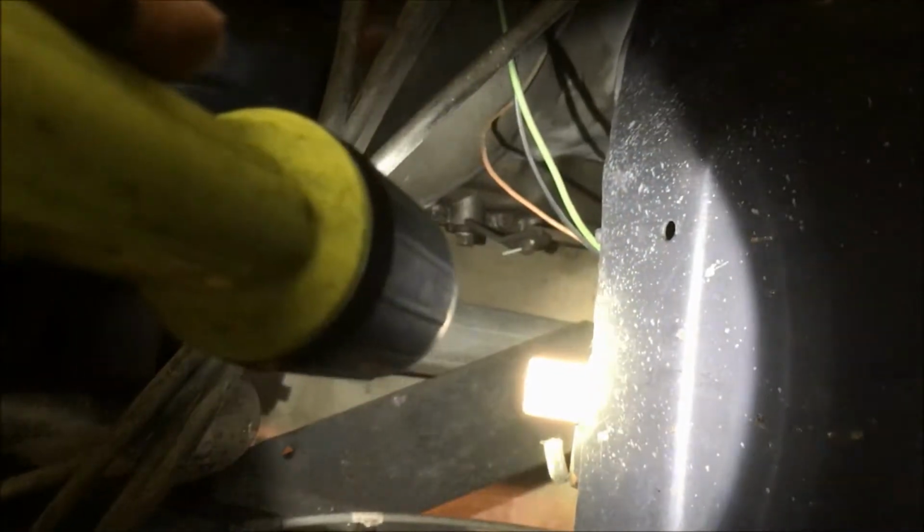It looks like I might be able to go with a U-joint down near the box and a U-joint up here, and that would make everything so much simpler. But I did mark the header tube. You probably can't see it, it's in black, where I want to dent it in a little bit. When I do that, I'll use that shaft on that end, some wood or metal on the outside end, with a C-clamp, and then heat it up with some MAP gas and see if that'll let it bend in a little bit. I'd rather not take it off, but if I have to, I have to. And then I would be able to steer again.